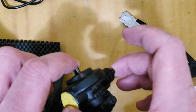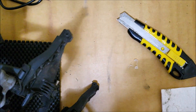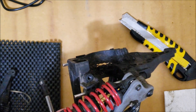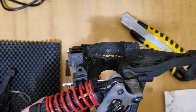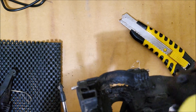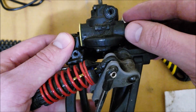I got the diff back together. Unfortunately I don't have stock bulkheads to reference, but I will show you kind of what I did to make them work. They're really chewed apart. You're going to be doing a lot of dremeling, but it actually isn't that bad — you just do a bunch of test fitting and then dremel away where it's hitting. Eventually you end up with something like this.